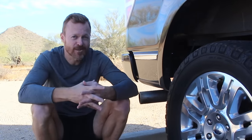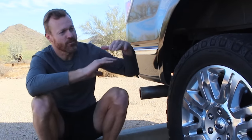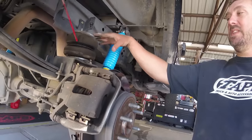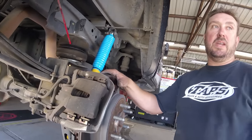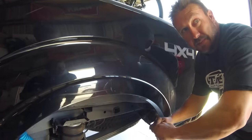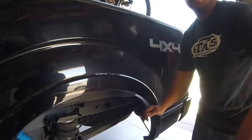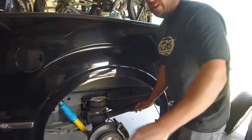If you've been watching the channel for a long time, you know the Firestone was actually installed professionally but incorrectly in Maine, and it didn't get fixed until we got to Paso Robles, California, where the bracket was basically upside down — it was taking all the weight instead of letting the leaf springs do anything. Also, anytime anyone disconnects their airline, they should cut a new one before putting it back on, because the barbs that hold the airline in make scratches and can pull it out past the O-ring. Check that video out if you're going to install Firestone yourself.